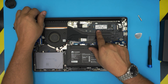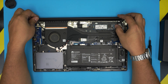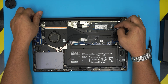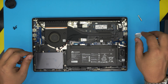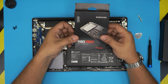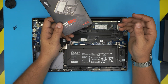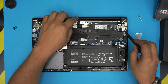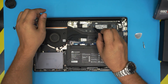The solid state drive is right over here. This is an M.2 drive which is PCIe, so you can install an NVMe drive, which is much faster than regular M.2 SATA. I recommend grabbing a Samsung brand — they have one of the best SSDs out there, very durable and long-lasting. I'll leave the link in the video description. You can put up to four terabytes. To remove this solid state drive, there's only one screw, which is a Phillips number zero — remove that screw right here.